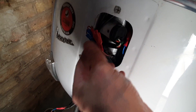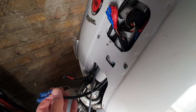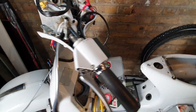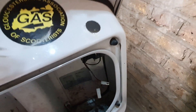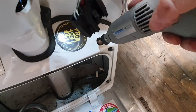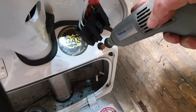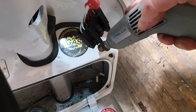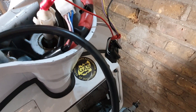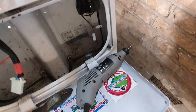Got the turn signals connected. I've got the battery gauge wires connected on this side, so it's more or less done up front. That's for the horn — this I need to extend and then route down towards the brake switch by the foot pedal. I'm still trying to make this hole a little bit bigger; the 20mm hole saw I used wasn't quite big enough, so I'm just going to use my Dremel.